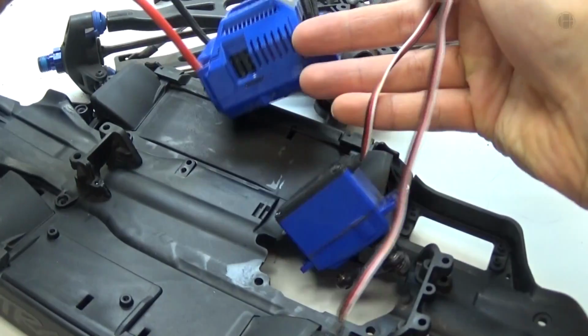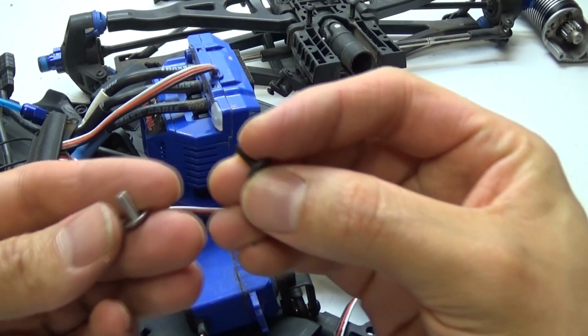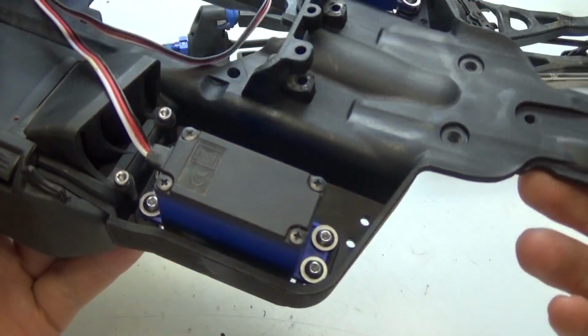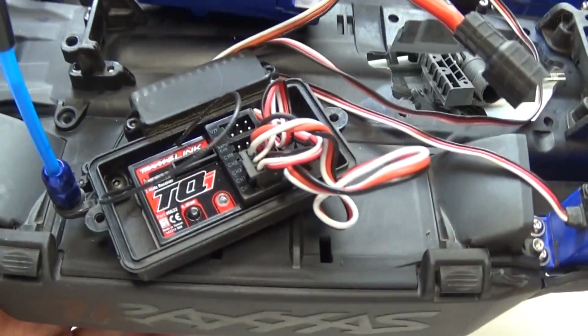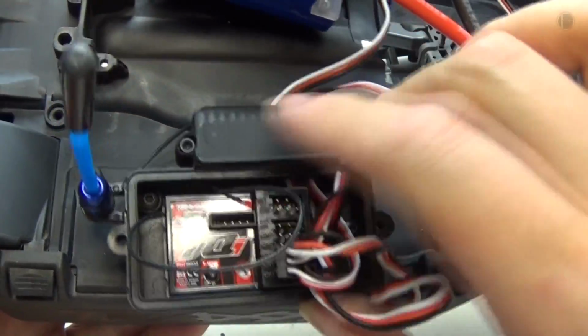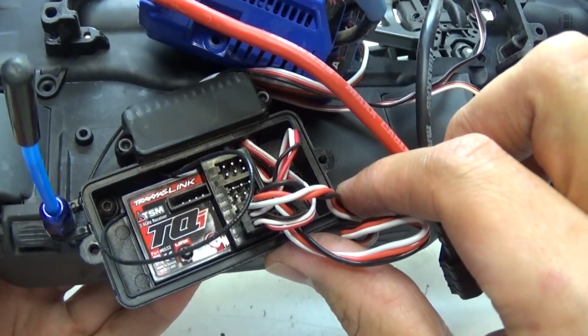First of all, I'm going to start off with the servos. Now, they don't include these kinds of screws, but they do include normal screws with a washer. Servos taken care of, now it's time for the waterproof receiver box. We have to replace the 2 screws that hold it down, the 2 screws that hold down the wire tie down, and then the 2 screws for the lid.